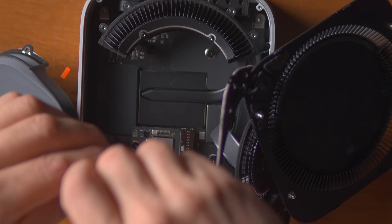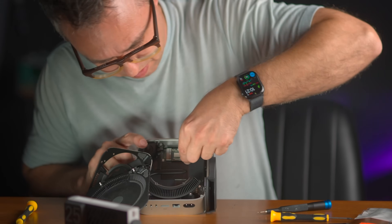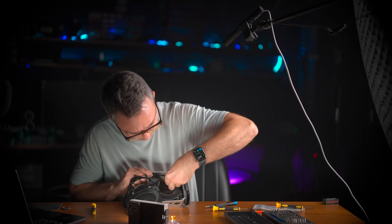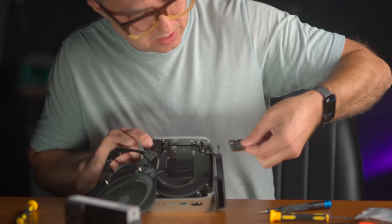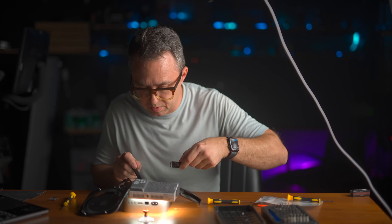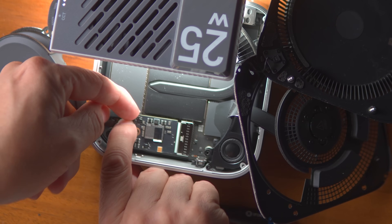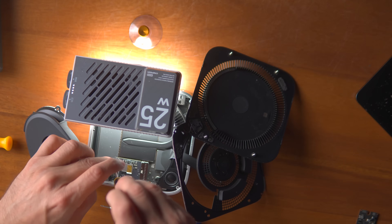This is a bigger drive. There's a T8 screw holding it down. Just give the drive a little wiggle and it comes out — that's the Apple SSD. The notch for the replacement SSD is right where this little tiny arrow is. Sneak it down in there, plug it on in, and we'll just work backwards.